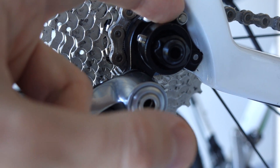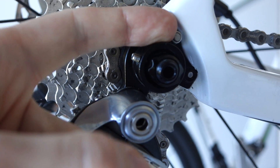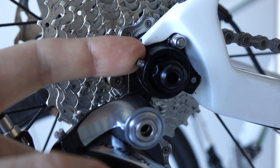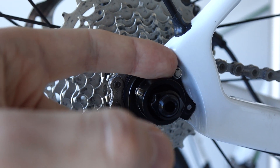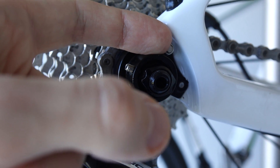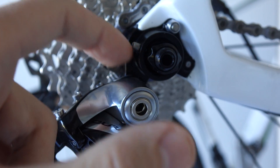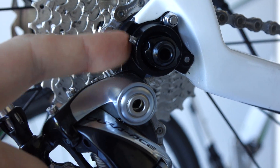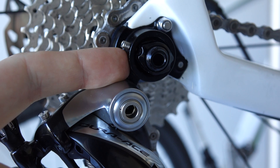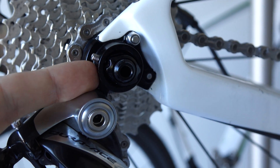What has happened is I was trying to tighten that just to stop it from moving, and I realized the top bolt wasn't actually able to go any tighter. That was because, obviously, when it was assembled in the factory, they tightened it too much and it had stripped the thread of this aluminium derailleur hanger slash dropout. With time, slowly, it was becoming worse and worse, more and more wobbly — with road cycling, a couple of thousand kilometers. No big potholes or anything like that, just regular smooth road cycling.